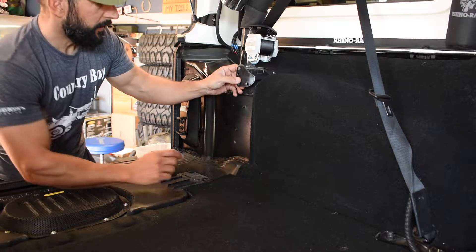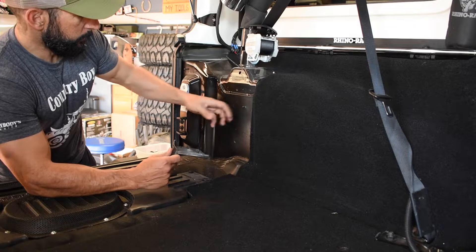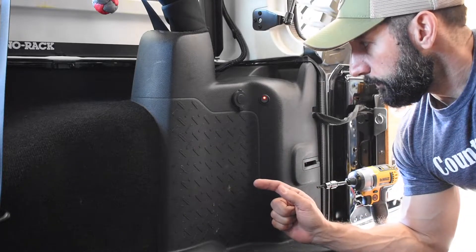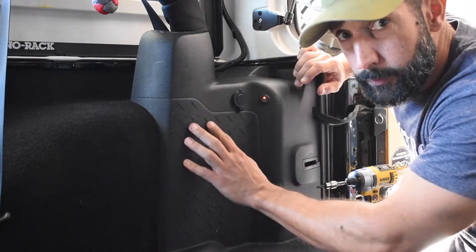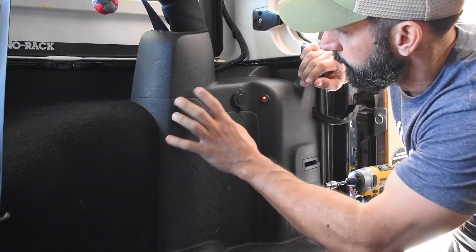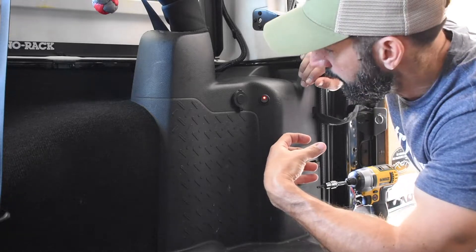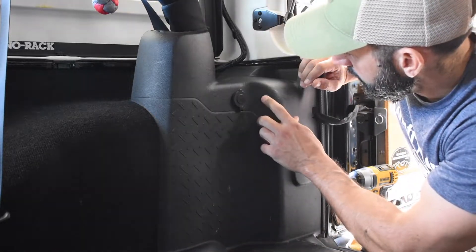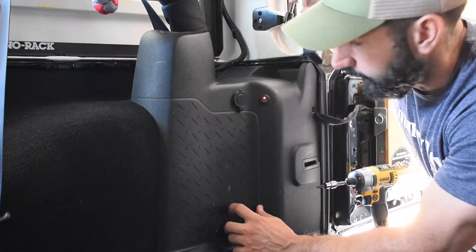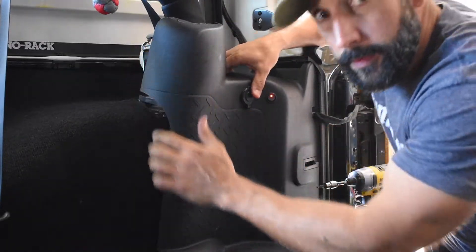I should have lifted it up and then pulled — I just broke that, but I don't think we're going to use that piece anymore. On this side it'll be a little different and tougher because when you take this off you can only pull it out a little bit since you may have a 12-volt accessory. What you want to do is lift up, pull out a little bit, and release the clip. I've also got a switch wired to a light on the rear glass, so I have both those parts to deal with.